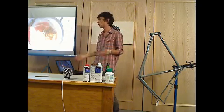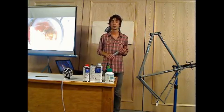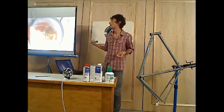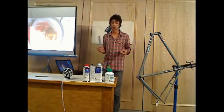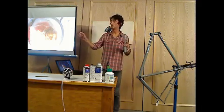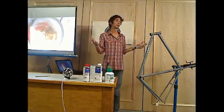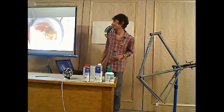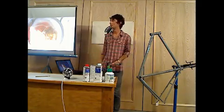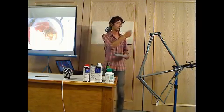And then the color, you usually take six more coats, like three or four for sure. And for this water-based stuff, it's totally different than what I was using before, which is solvent-based. This takes a long time to dry, and it's very wet and holds a lot of moisture in it. So they actually use an air amplifier. It's basically just a hair dryer. You could use a hair dryer if it was explosion proof. It would actually work better than what I have now because it would be hot air, which would be awesome. But basically it blows air out, and you just go over the whole frame